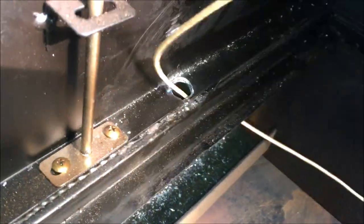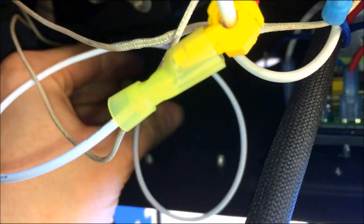I filled the holes later on with some high temperature RTV to protect the wires and to prevent any heat loss. Next I just pushed the wires through the holes and down next to the hopper. Again, your hole should not go all the way through to where the pellets are. Now I'm fishing the yellow male connector wire through the hopper and crossing my fingers hoping everything is long enough. To my relief everything is the perfect length and connected together without any issue. Even the T-Splice connectors stay together. Now I just have to do the same with the other wire with the blue female connector — this is the one that will plug into the other end of the switch.